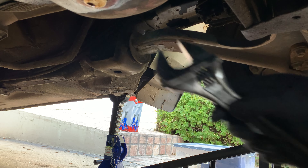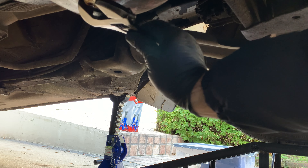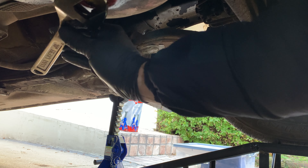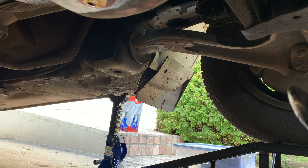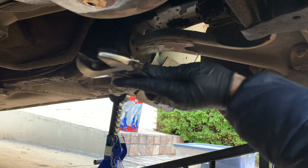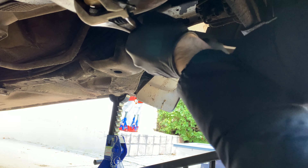The car is already on ramps and being held by jacks, so time to go under it. You'll see there's like an oil drop on the oil drain plug - that's because last time I replaced the original plug with a magnetic one. But I'm not super happy with it. No matter the torque you give it, there's just a drop of oil continuously coming out. It's not a matter of tightening - it's just a matter of fit.